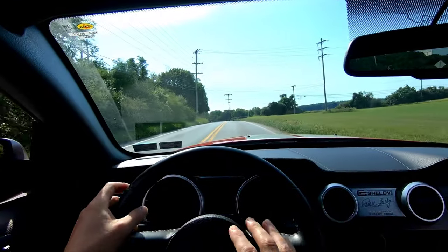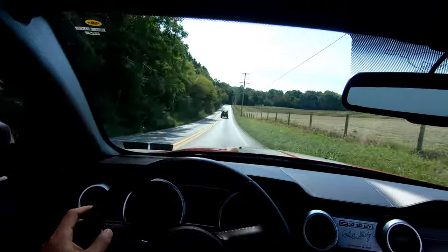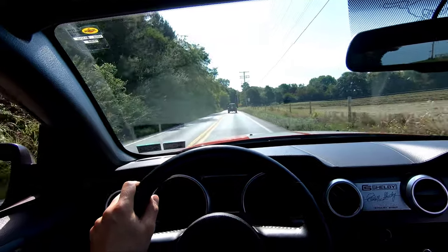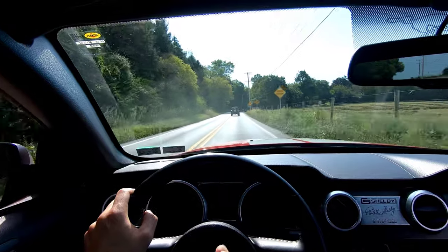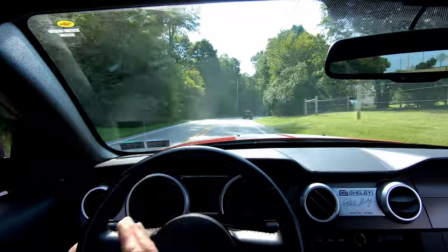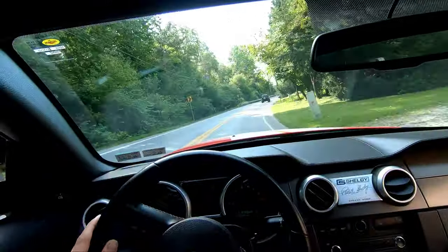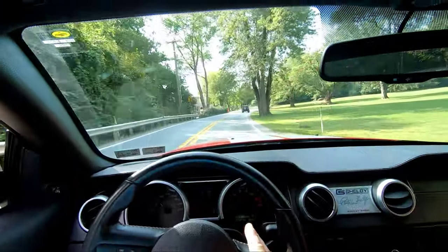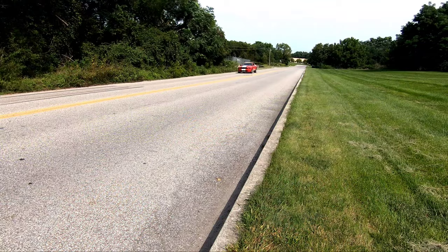So I did notice a little bit of a torque loss with the H-pipe. Not gonna lie there. Little bit of low end torque gone, but I'm trading it for some higher end horsepower. I can feel it pull a little more on the upper RPMs, and the RPMs definitely climb faster than they did before. So it's a bit of a trade-off. You're moving some down low power up top. So it's definitely nice. I never actually was able to chirp or spin third gear before, and now it does, so it's pretty obvious there's more power.